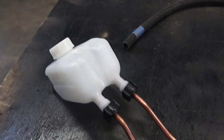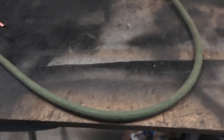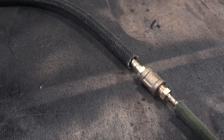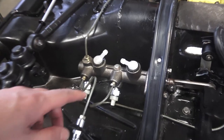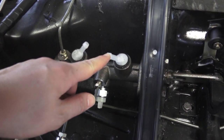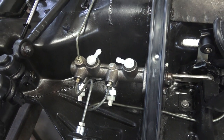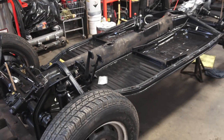This is how you attach it — basically right from there the green hose, then your junction like we showed, and then your 7mm braided line. Please use the braided line — the correct brake hose — to work with this. Then that brake hose will go on the dual master. Make sure you use the clips and fasteners on those hoses.